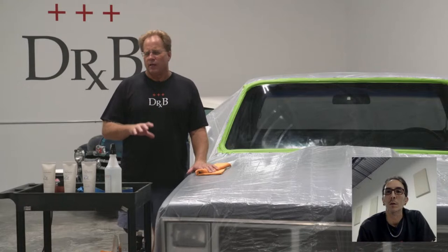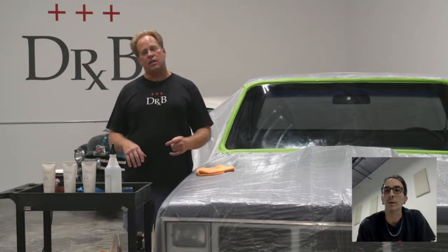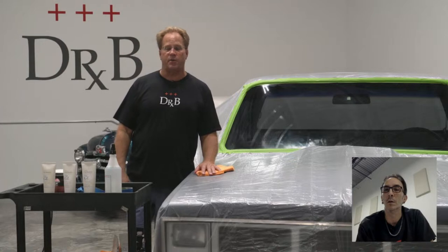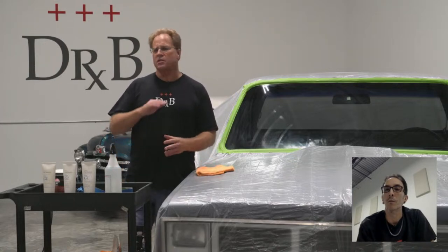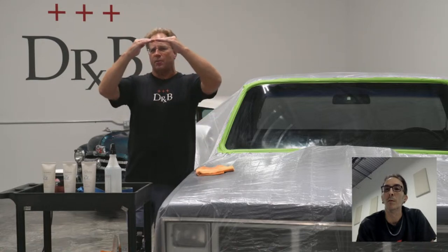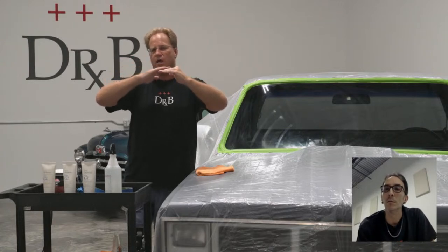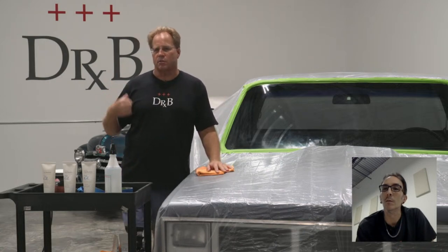Pits, you know, people ask me all the time, can you remove pits? The problem with pits is they tend to be deeper than it looks, so they're like a deep scratch. So yes, you can remove them. I've done it. I did a Mercedes-Benz, had tiny pits, took them all out just using the glass polish. But it just depends on how deep they are, because the whole goal, if you've got a defect in the glass, you have to take the upper surface down to the depth of the scratch or the pit you're trying to remove. So all that material's got to get removed off there. So just back to patience, persistence, a little bit of deltoid muscle.